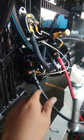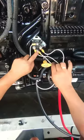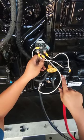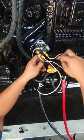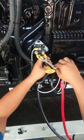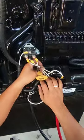Later on we're going to arrange those wiring. So we are now connected. Once again: this one is negative connected to our negative; number four is connected to our module command; number seven is connected to your positive; and number two is the positive switch going to your starter solenoid. That is the wiring from this type of relay. We're going to finalize these connections and put some liquid tight here — it's done.